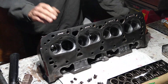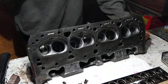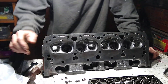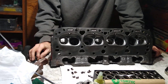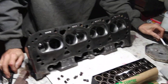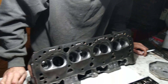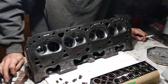You can't beat the runners on the camel hump — they're just straight. Now, this motor's not going to run until May or June, maybe April, but it's going to be a while. Everything will get lubed very well using assembly lube. This motor's definitely going to smoke on startup because there's going to be a lot of assembly lube in there. But I just like to overkill the assembly lube myself — no such thing as too much, especially when you're storing a motor for a couple of three months before you run it.